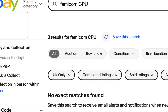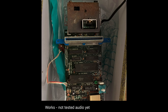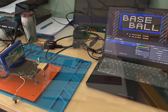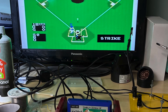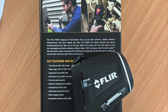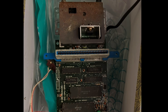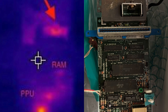And so we return to the diagnosis of dead CPU and how to go about testing whether it's still an issue. Original Famicom spare parts are exceptionally difficult to come by in the UK. Fortunately the museum seems to have made friends around the world, and we were pretty gobsmacked to receive three original boards direct from Hong Kong where they can still be found. One of these we nicknamed Miracle — in spite of its rusty grotty condition it works without so much as a basic clean, and this was pretty crucial in providing a reliable model to test against when diagnosing the system. Another extraordinary stroke of luck was acquiring the loan of a thermal camera, something way out of our budget but could be of enormous help in quickly visualising how the two boards react when under load. This side-by-side illustrates the heat signature when functioning correctly — we can see a healthy indicator of key components like the regulator, RAM, PPU, and CPU.